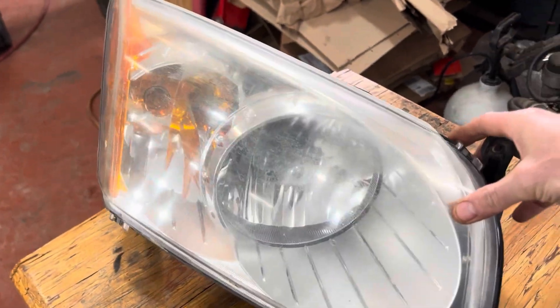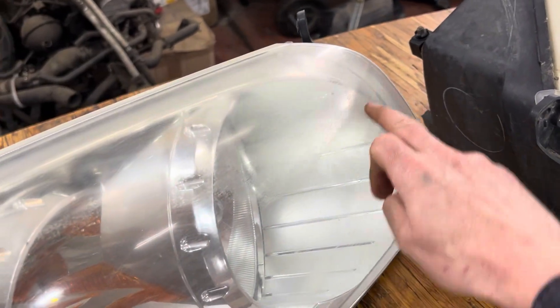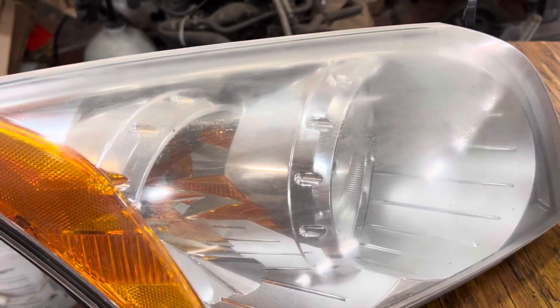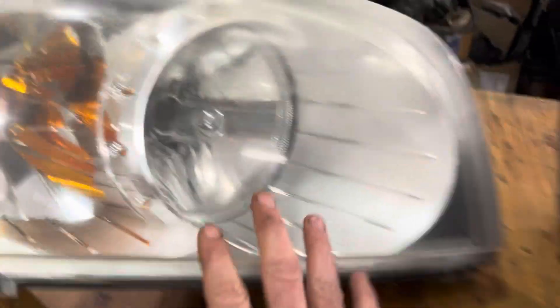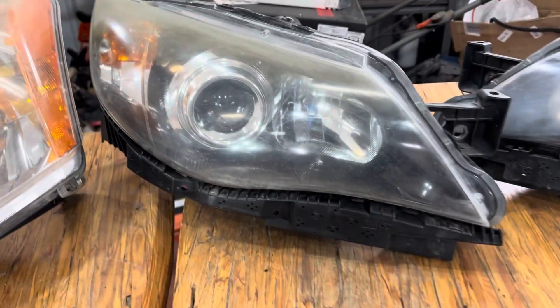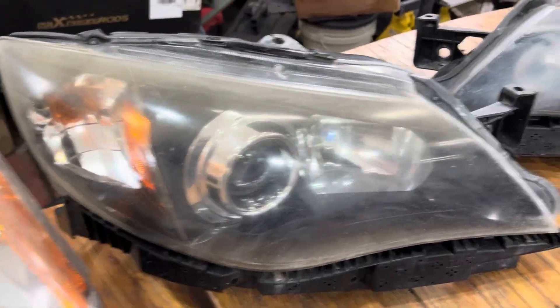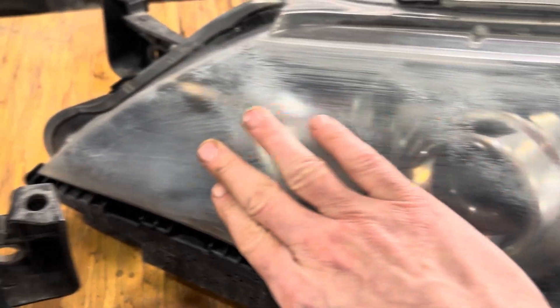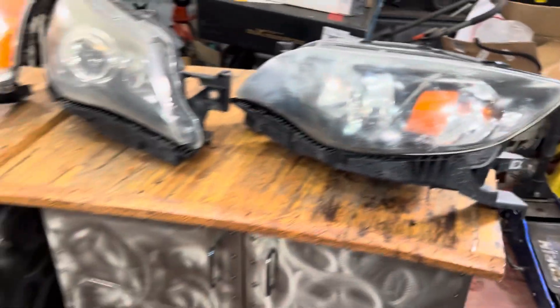Before we sand, let me show you what we're working with. There's this haze here — it's oxidation — and when the light shines, it diffuses against that and makes the lights not work so well. The lights are designed to diffuse out on the road, not against the lens. This one has quite bad hazing, and the second one — the driver's side — has a hazing mark that goes across the center. These are out of a Subaru and they're in bad shape. It's my daughter's car and she's been complaining about it. Someone had tried a solvent fix on a spot, which actually worked okay there, but wiped the hazing into other spots. All of this is going to be sanded out.